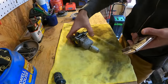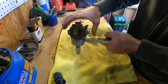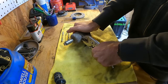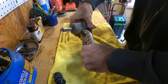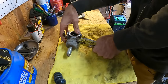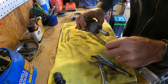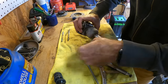Y'all saw me get that carb off. A lot of times these have screws that are extremely difficult to get out without stripping. Most of the time I'll just get a set of vice grips on here to at least get them cracked loose. I'll go ahead and take these bolts and that choke linkage out — it was in the first hole. There we go, that one cracked loose. That one cracked loose too. That's the best way I've found to do these. Then we can just take a screwdriver and take it the rest of the way out, because otherwise you'll end up stripping them.